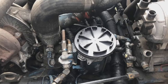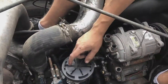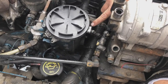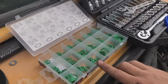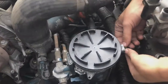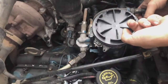Now, we lost an O-ring that was out here. When we were trying to pump this up and get the engine started, the diesel started pouring out of here because the ring right here was broken. So we bought some new ones, and this is the type we're using. We'll link it in the description, but it has all kinds of sizes, so it'll last you your whole lifetime. Put the ring in there and slide this back in. This is how I lost the old ring.